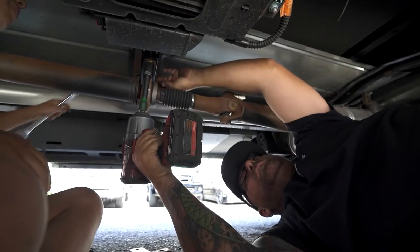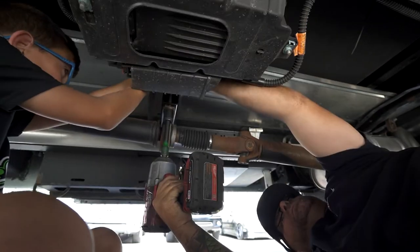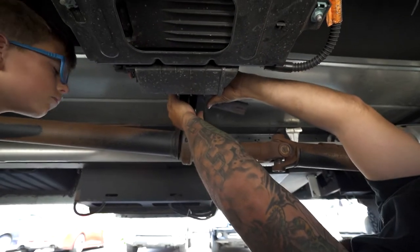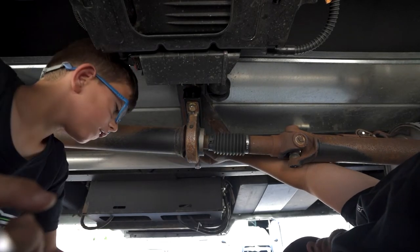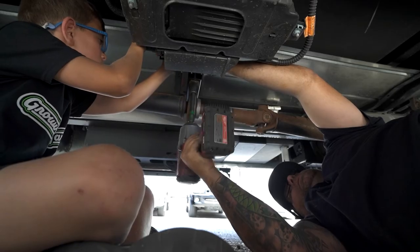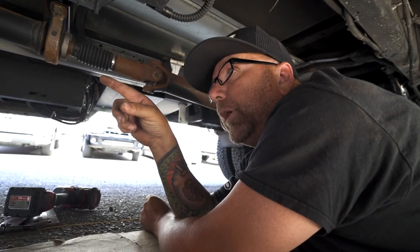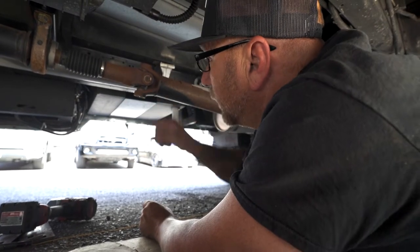So what I'm going to do now is take one of the quarter-inch spacers and put it in here. Let me show you how to do that without dropping everything down. I loosened up one side, I'm going to take this bolt completely out, fit the spacer in without dropping everything down. Now we're going to take one spacer, take the bolt, put it all back together. I'm going to push it in there and then line everything back up inside there. And you can see now we're getting that a lot more even. So the next thing we're going to do is take a look at that front driveshaft carrier bearing, see if we need to lower that down just one quarter-inch spacer, and that's going to help this as well.